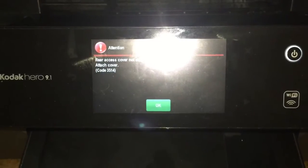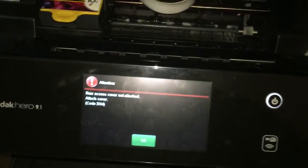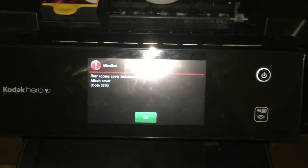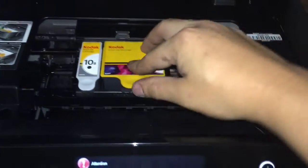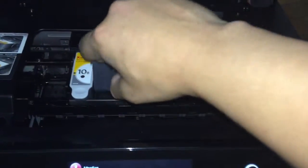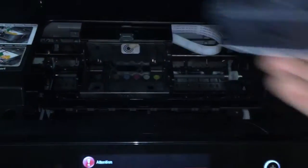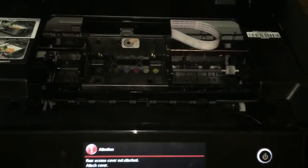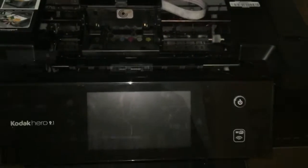It's a good thing I had this error message after it popped up. You also have to take off the back cover part that rolls the paper over — sometimes it's a duplexer, sometimes it's not. So you'll have to take that off. I got this error message, but then the ink cartridge cradle here came out, and you can just remove the ink, then unplug it, and then we can start taking it apart.